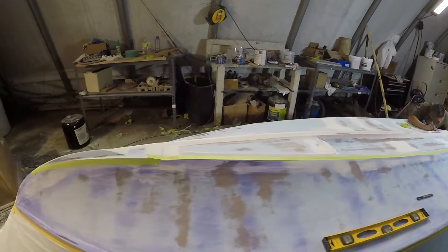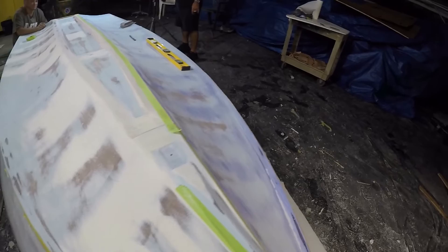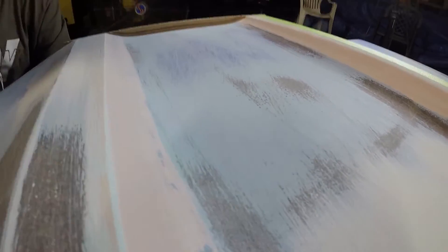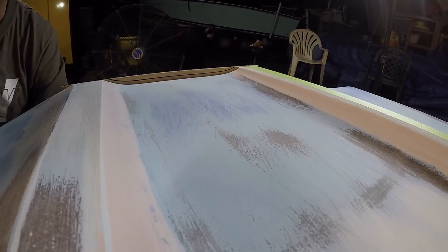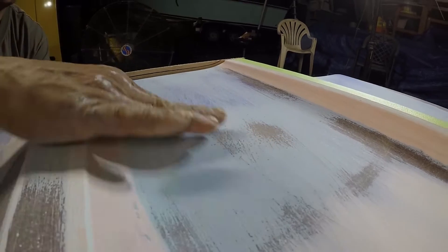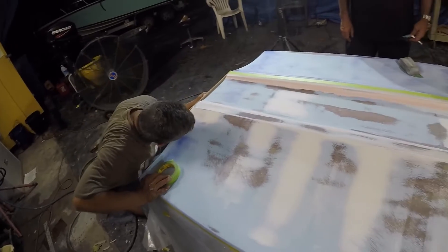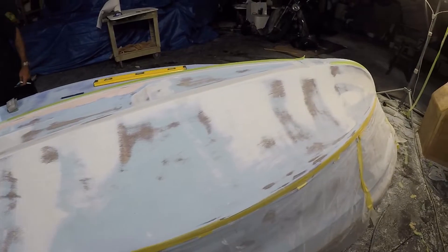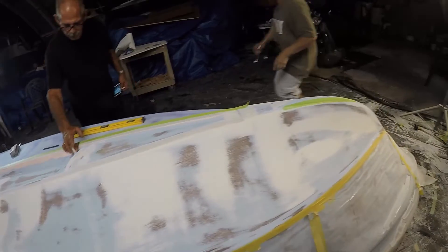We're back and we're filling all the blue spots on this side — see how we fill them in with P77. Here's the lip that we want to add to help bring the nose down so you don't need trim tabs. That's roughly the height we want to go — a little pad from about right here to there to lift it up so it pushes the nose down while running. All the dark blue spots are gone, they're all filled with white, and he sanded it so it's all even.